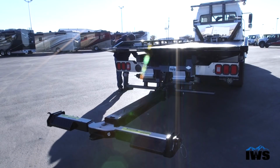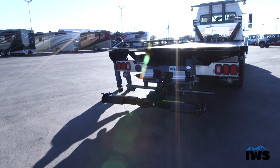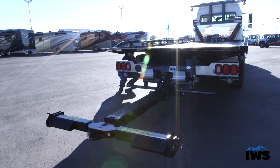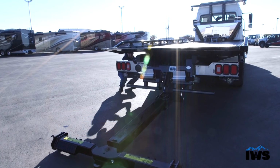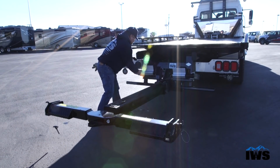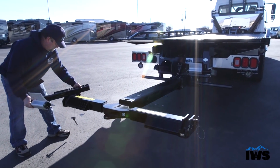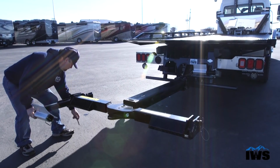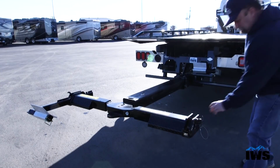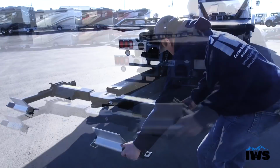The Chevron Series 12 LCG is equipped with a 4,000-pound rated independent wheel lift. And since we've upgraded the hydraulic pump on this bed, the speed of the wheel lift is dramatically improved. Now, the wheel lift has a rating of 4,000 pounds, whether extended or retracted. And Chevron's L-arm system is the best on the market. The U-channel is simple to set the L-arms into, and two positions for a pin location always ensure that you'll have the ability to fit whatever size tire without wrestling too hard with the L-arms.